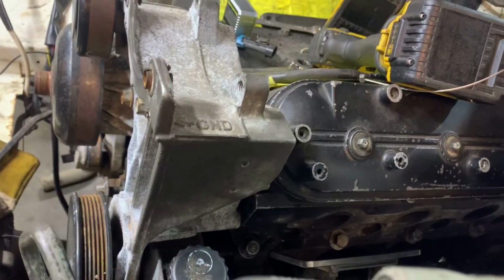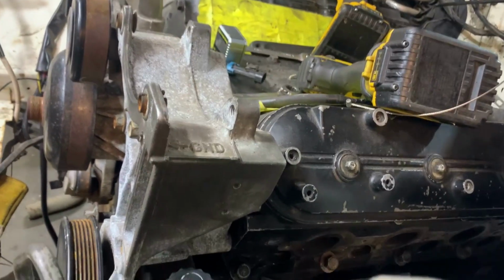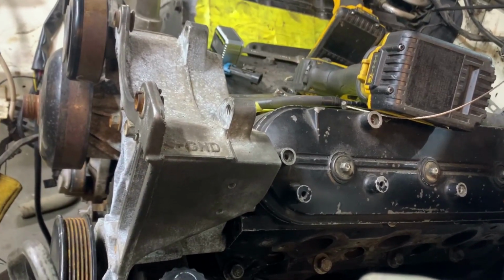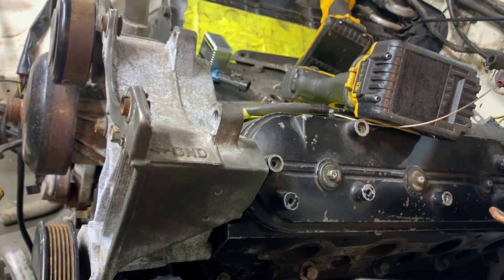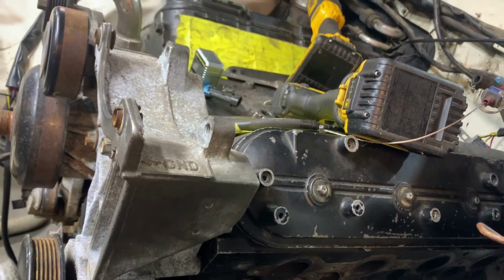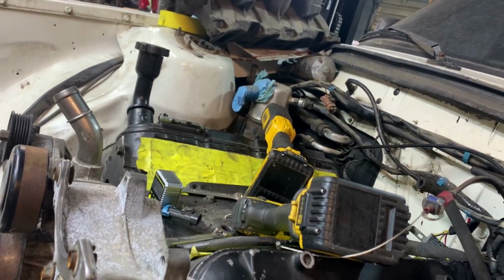I pulled the steel out from under. Nothing under it anymore holding it up. I'm just trying to get it mounted up. I got something else that needs to come in. That was the goal of this, just to get it mounted. I'm not gonna finish weld it just in case I need to readjust something. I'll probably pull the mounts out, put a couple better tack welds here and there so they're good and sturdy, no worries about any movement or anything shaking it loose. And then this thing can go out and I can pull the truck in.